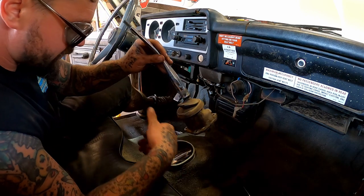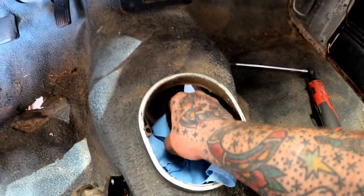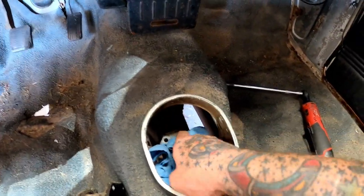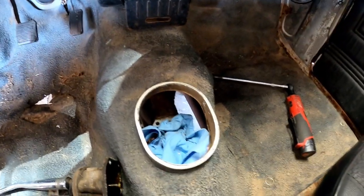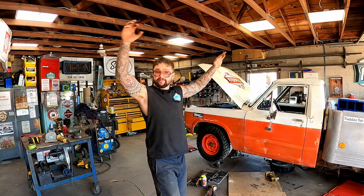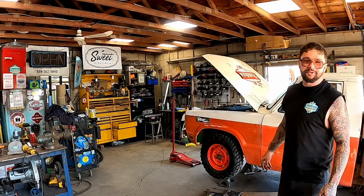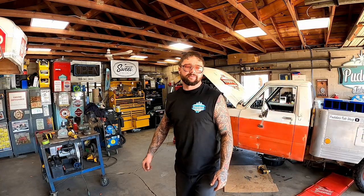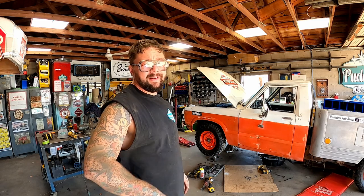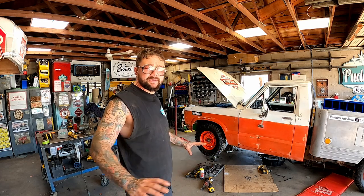Pull those four bolts. And we pull that shifter, and we're gonna shove our towels down in here and try to keep some debris out of that anyhow. There we go. Have you girls stretched out today? Don't want to tear a damn rotator cuff. I don't know what that thing's called. Feel like bench pressing? Hell, you better, because we ain't got a transmission jack. We got a regular jack, but you know, these little mini truck transmissions, we curl them, so we'll damn sure bench press them.